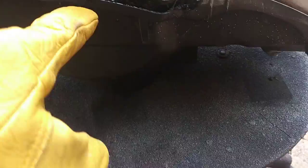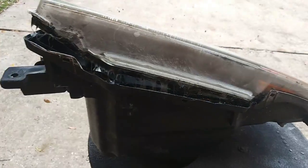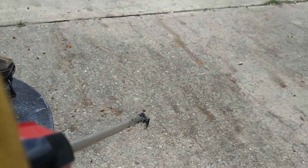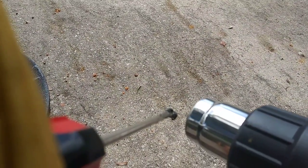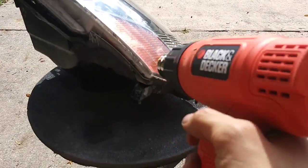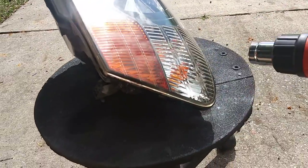I just kept prying my screwdriver in from the corner — you can see I bent it a little bit here and I kind of just squeeze it in between as I heat it up. You can see what the glue does. What I did on the first one was scoop some of that glue off from the corner. Then all I did was turn on the heat gun and after about 20 seconds the glue basically liquefies and becomes very gooey. Or you can just do it right and use the oven, but here I am.